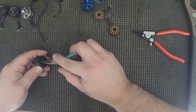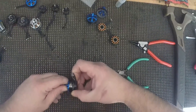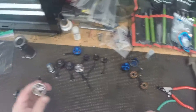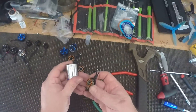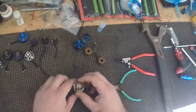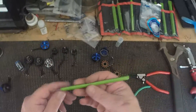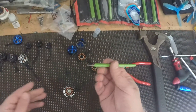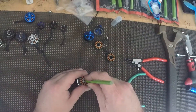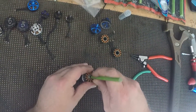I've already pulled my C-clip out to make it easier and quicker. I like to use a 22mm socket. I like to start with this bearing first. I have a little small punch here — this one is a 1/16th inch punch, which is 1.5mm. You can use a small drill bit too.